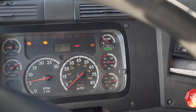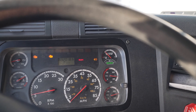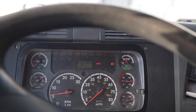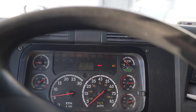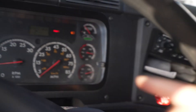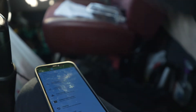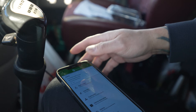Force regen — 40-minute duration. Fault codes: commands — reset all fault codes — confirm. We don't have any more fault codes! But why is that light still on? I've never seen that light before, even after a regen. I've got no codes, cleared. Let's look at the live data.